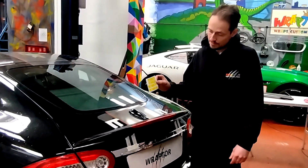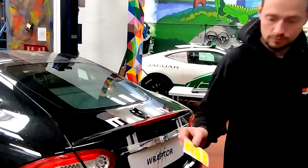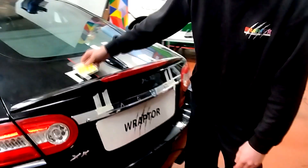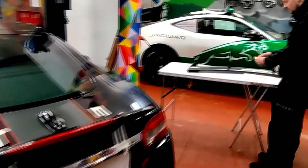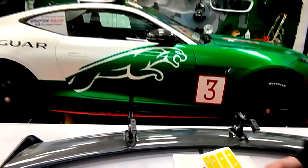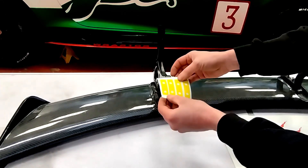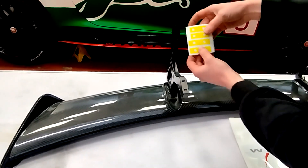Within the kit we supplied these templates to help you drill the holes. There are two long ones and two short ones, and they're going to sit right inside your masking. You need to check that you are using the correct ones in the correct places. I recommend turn your spoiler upside down, offer up what we've got — that's the short one and that's the long one.